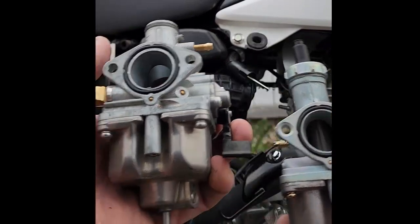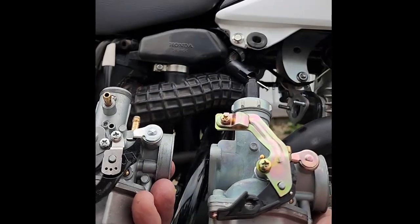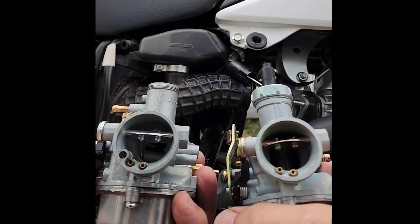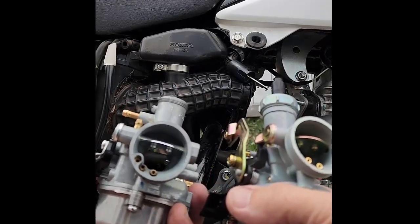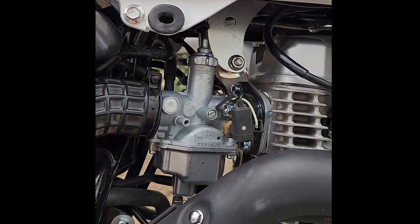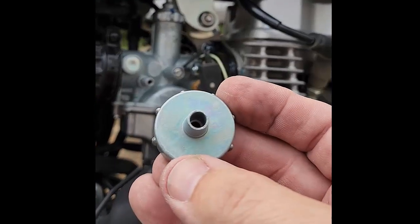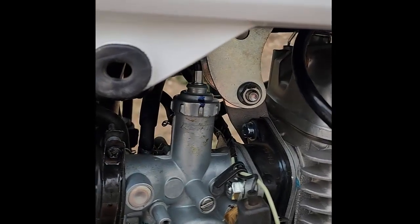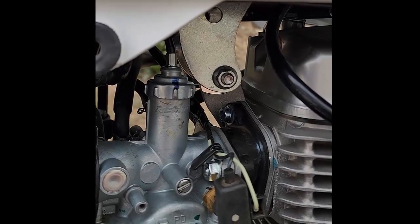My left hand is the original Honda carburetor and this is the PZ27 — a very similar carburetor. Let's slap her in there and see what happens. Well, that's disappointing — mission aborted. The cap here is pretty typical; the cable just sits down inside of it and seats up against the stopper down there. On the Honda, it seems like they've gone out of their way to make this so that you can't work on it or modify it yourself.